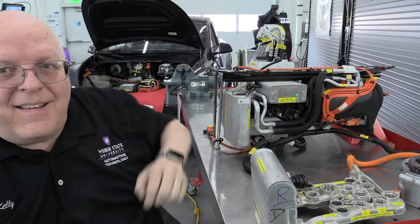We don't need an extra PTC heater installed on the vehicle. We don't need extra parts installed to generate heat in low temperatures. We just use existing parts and can operate them purposely in a lossy, inefficient manner that creates extra heat. All that extra heat ends up in the refrigerant, compressed by the compressor, heat concentrated, which raises the temperature of the refrigerant, which is then sent to our cabin condenser and air blown through it to keep you warm while you drive down the road. So a pretty amazing system, and quite a wide operating range there, which is quite impressive.